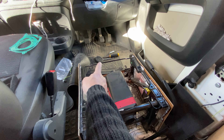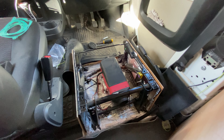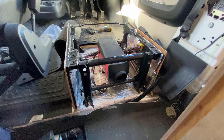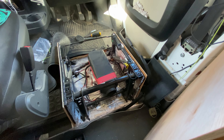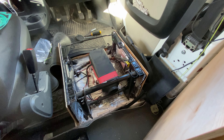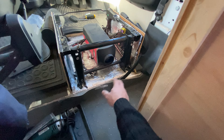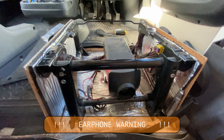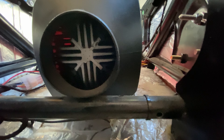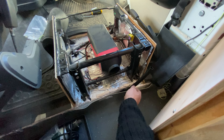This is hot and it's so much quieter. I'll replace the cover, put the seat back in with all six bolts — one, two, three, four, five, six — and that's the job well done. It only took about 20 minutes because I was rummaging around for my tools. It's a very easy fix and I'm going to keep an extra glow plug in the van just in case. This was a fairly new heater — I put it in about six months to a year ago. Thanks so much for watching. If you drop me a like and subscribe that will help the channel immensely. See you in the next video!